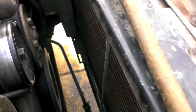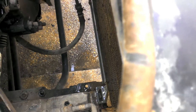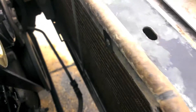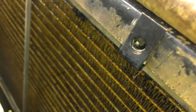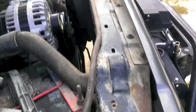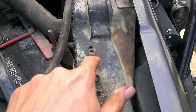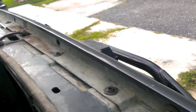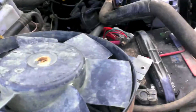If you look at the radiator there's a little mounting foot area on each side, but one is too far and too close to the line. It did have a hole drilled out, so if you can find a fan that fits you don't have to do any work. For this one I'm mounting it on the other ear — both legs don't fit in those ears since one has a wider gap. I drilled a little hole and used one of those clips so you can just screw it in. I took the whole radiator support out — it's only a couple bolts, three on each side — and pulled the metal bracket with it since the star bolts are mostly broken anyway.